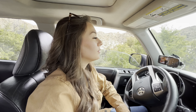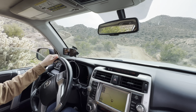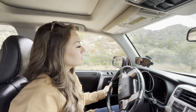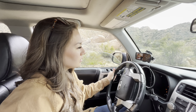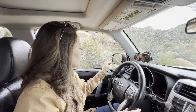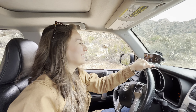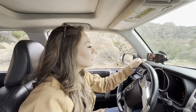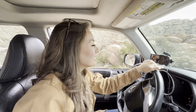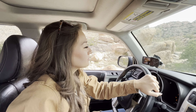Now what do I do? Let's go. Put your left tire on the side that has the pavement and go through that little obstacle. I don't want to make today's trip too easy — I want to kind of push the truck a little bit. And that's what makes Toyota really good, because it has that A-TRAC button to stop the wheel that's spinning. That was a dramatic difference. Jeeps don't have that — well, to be fair, I don't think a Jeep would have been stuck there anyway because of the solid axle — the tire would never have lifted off the ground. It's got way more articulation and down travel, as opposed to an independent front suspension.